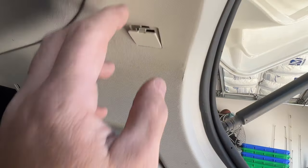And then you can pull your whole strut out of here. Since I didn't buy the whole strut spring assembly, I'm going to have to reuse this spring. I went with the Monroe 72896 OE Spectrum struts for the rear. I went ahead and just mounted this in our vise here, and then rented a strut spring compressor from Advanced Auto Parts. So let's go ahead and start compressing this spring.